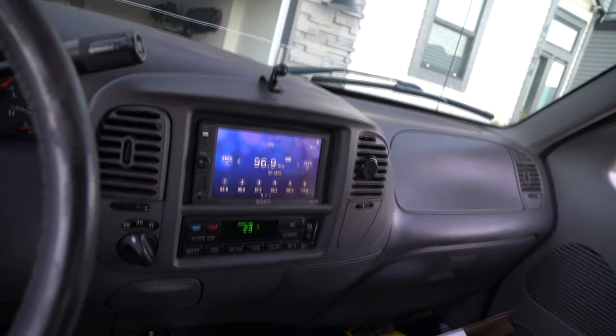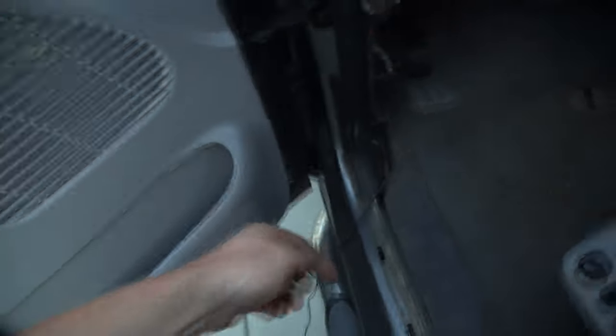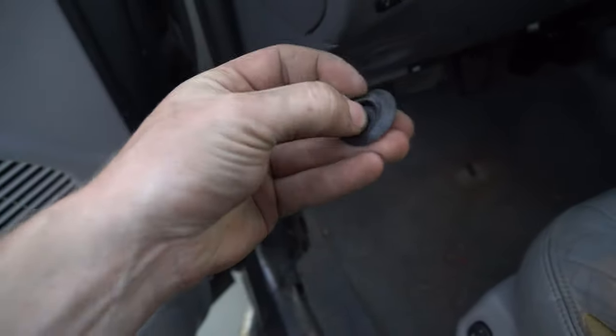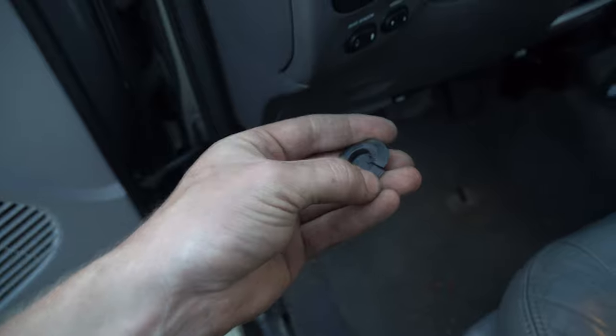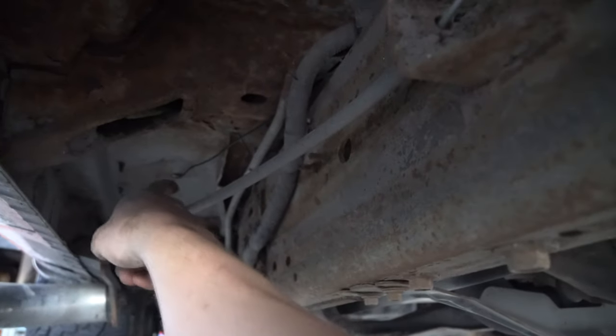Solder that, tape it, and let's get that camera wire to the rear. The simplest way ever to do this: cut your grommet all the way to the center like this. Run your camera wire down the hole, and when you seat the grommet back make sure that camera wire is right here — the rubber will keep it from being cut by the metal. If you're worried about leaking, you can throw a little bit of silicone across there. Then I passed it through up here, zap strapped it onto this wiring harness, all the way down the truck body protected by the frame.